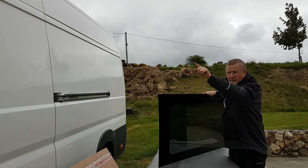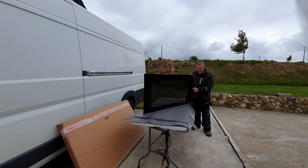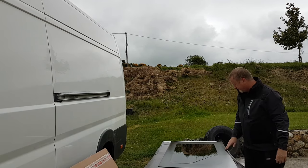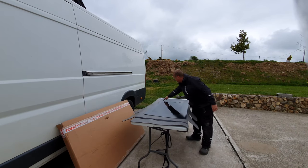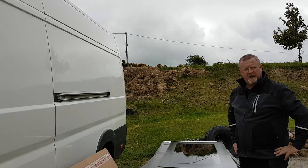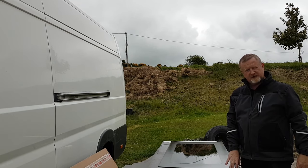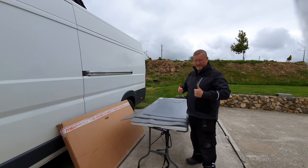We need to cut out a hole in the panel, bigger than this internal piece, but that gives us plenty of room to leave lots of metal all around the van. All we basically do is cut a hole bigger than this in the side panel of the van, apply some adhesive, stick the window to the adhesive, and tape it up from the top to stop it sliding down until it sets. The adhesive that comes with it is one-hour adhesive, so basically within one hour of applying the adhesive and sticking the glass on, it'll be good and ready to go.